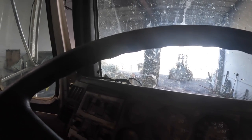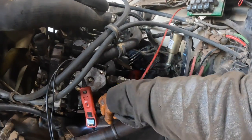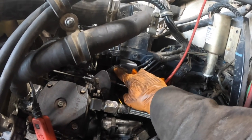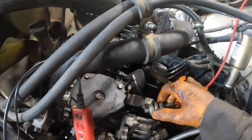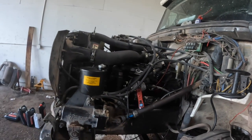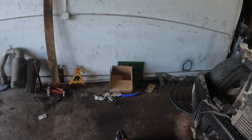So now the next thing we got to contend with, all I really got left to do is zip tie a few things up, of course the hood, but I need to do the air conditioner. The biggest thing is I have no throttle. This is the same right here. So what I'm going to do, I'm going to start scavenging around here right now. And I'm just going to come back like this. I'm going to build a bracket because I've already got two nuts here. I'm going to build a bracket out of some angle iron or something. And then I'm going to just basically drill a hole for a bulkhead connector. I got to get it kind of back there to where it's right. And there you go. So, I guess I better get on the hunt for some metal to build that out of. But this thing always had green antifreeze in it, and I put ELC red extended life coolant back in it.